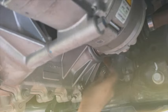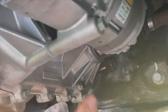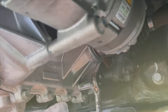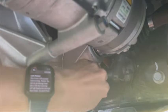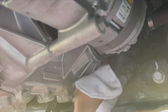I can now go ahead and install the fill plug and tighten it down. VOTEX doesn't actually specify a torque amount for the plugs, so what I do is tighten it down until I can feel that the crush washer is starting to yield.